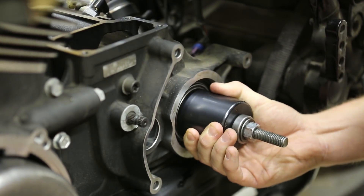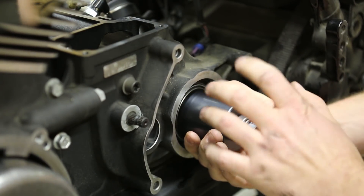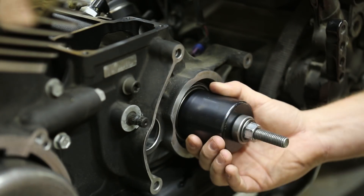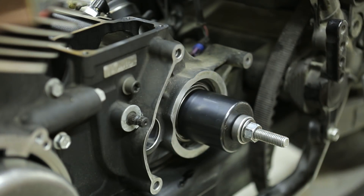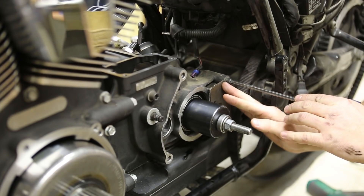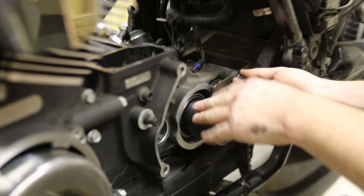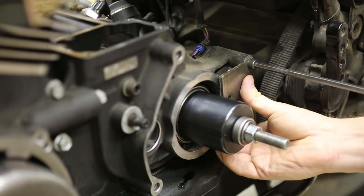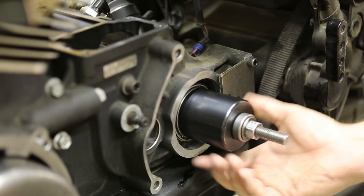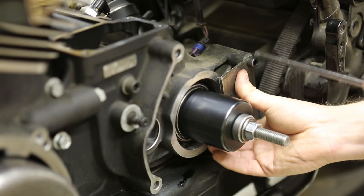And if you listen closely, you can hear it has a little tongue-tongue-tongue sound. This bearing seems like it's set up correctly but I'm going to go ahead and do the next procedure which is check it with a dial indicator. When you're installing this tool, it's just a flat plate. You can actually use the install tool plate too if you'd like, but make sure that the plate doesn't hit the main drive gear. It hits the tool, so you want to make sure it can still spin a little bit freely if you need it to. So we can check a couple different locations on there.